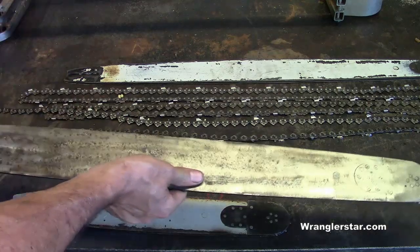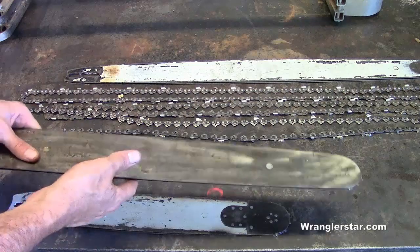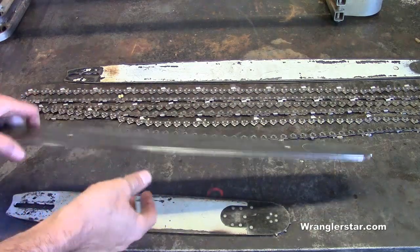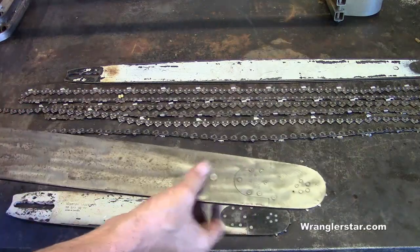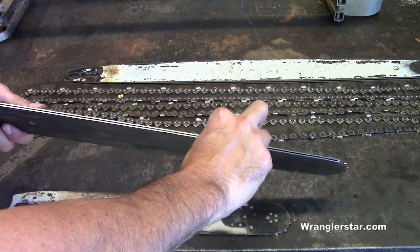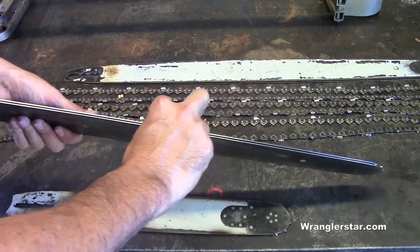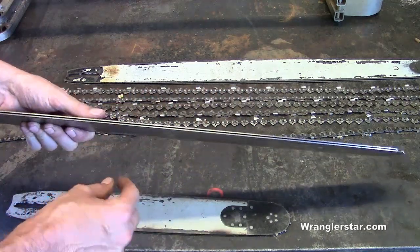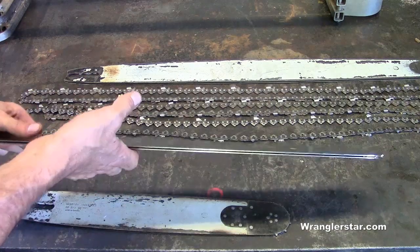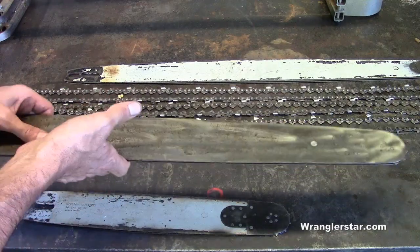You know, a pro bar like this, 32-inch, will cost way over $100. And I've had mine repaired and repaired and repaired many times, from getting bent to just being overly worn. There's a lot of things they can do. In addition to repairing the tips, they've got special tools, and you can buy these yourself, which squeeze this gauge back. They'll reprofile this, basically put it back to its original settings, and you can get more life out of the bar. And I think the saw shop that I've used for years to do that charges about $12. So really a good deal.